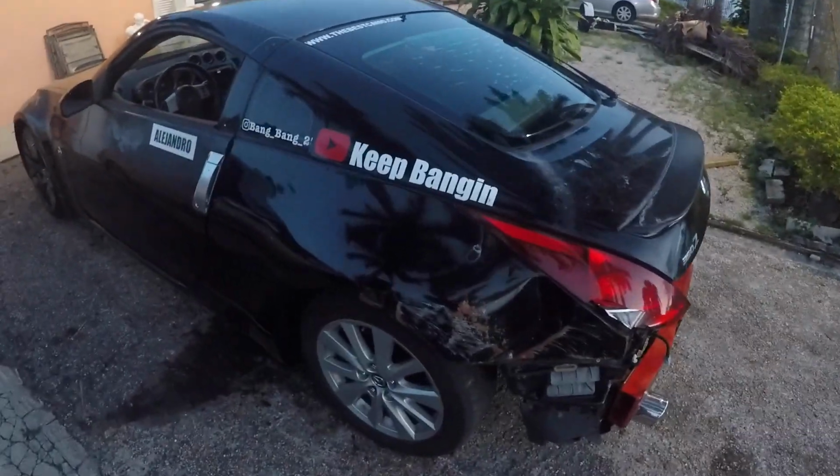As you guys were able to see, it worked pretty good. Unfortunately, the left side isn't really locking up. I think it has to do with when we fixed that side, we probably didn't adjust it well. I tried doing the best I could from before taking out the rotors, and yeah, left side isn't locking up. I'm gonna leave that for another day, probably another video. I think it's when we crashed. Well, not when my brother crashed, we changed that whole knuckle. Something wasn't done right, but at least it does it very well with the right side.